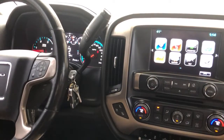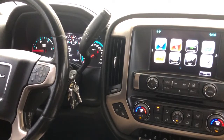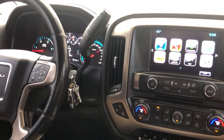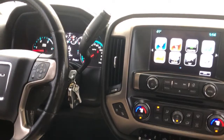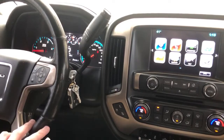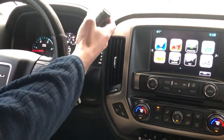This is a quick video on how to use the two-wheel drive low range function on the Autosync. This is for if you want to have the low range gear reduction but you don't want to be in four-wheel drive — for example, if you're backing up a trailer where you want low range but you don't want your tires scrubbing when you're turning back and forth.